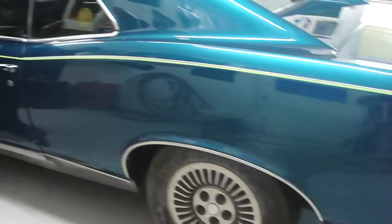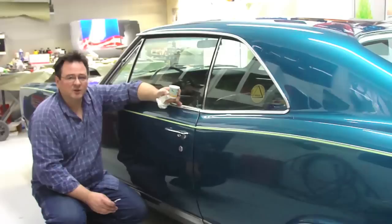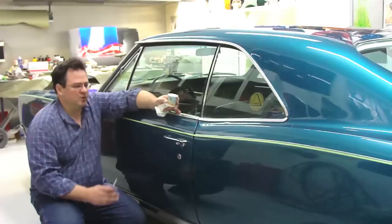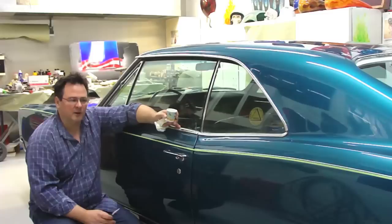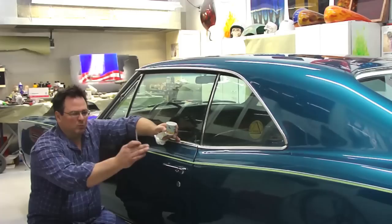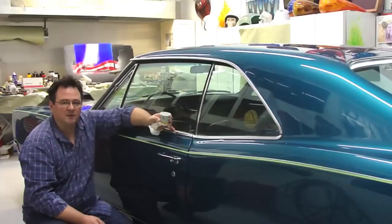I just wanted to talk about the reason for the quarter-inch tape. It's basically just a guideline for you to run your pinstripe next to. I'm not actually running it up against it, just holding the distance. I use it as a tool. Some people say you're cheating because you're using stripe tape, but basically it helps even out the body line and makes sure you're putting the stripe correctly on the car. After we do the first line, I'm going to remove the tape and then hand-run a smaller line underneath, keeping it as even and consistent on the stripe as possible from one end to the other.